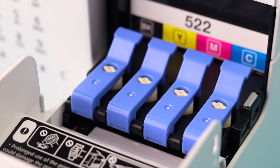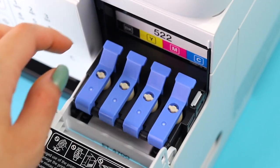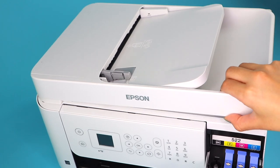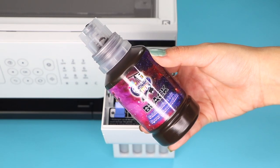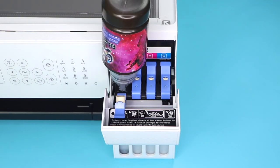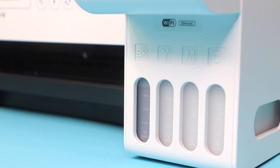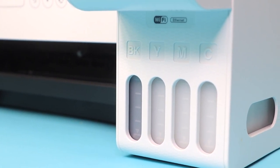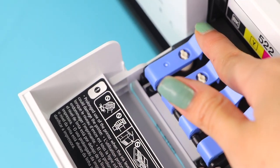There is black, yellow, magenta, and cyan. Each tank has a blue lid — this is where we will be filling every individual color with our sublimation ink that matches the label. Insert the ink bottle into the correct tank and let it sit. You should hear a gulping sound, which means the ink is pouring into the tank properly. Do not squeeze the bottle — just let it do its own thing. Once the sound stops it's time to remove it, and the tank should now be completely loaded with ink.